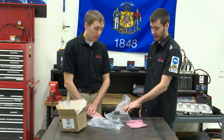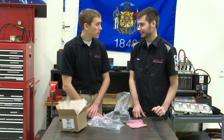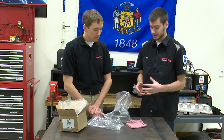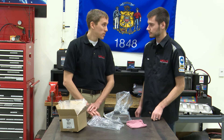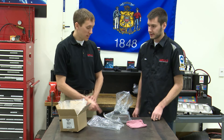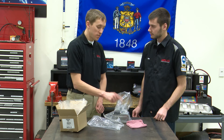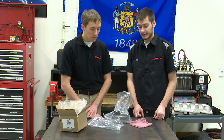There have been some redesigns and improvements to this part. If something has been on vehicles since 1989 you'd hope there are some advancements, and there have been — it's quieter, you don't need the sound shield, it doesn't leak as often. A lot of improvements on a part that's been out for almost 30 years. Also note: the Mitsubishi versions — the Dodge Stratus coupe and Chrysler Sebring coupe from 2001 to 2005 — are not the same four-speed. The two-door coupe runs a Mitsubishi transmission; the four-door sedan will work with this solenoid.